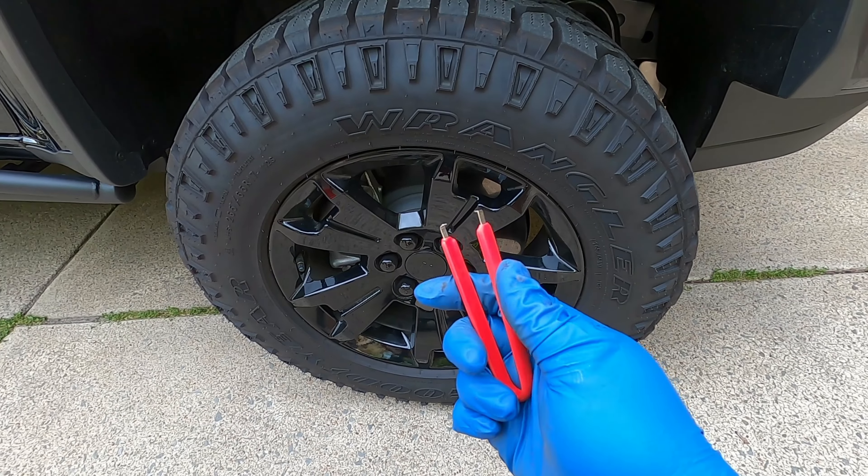If you've made it this far, you are pretty much done. When you get to the step of reconnecting the sway bar — if you're doing the passenger side after the driver's side — the sway bar doesn't have any give. So if the bolt is not long enough, you're going to want to employ some sort of jack. In my case, this is the factory bottle jack underneath the wheel spindle — just push up on everything to show enough thread to get the stock nut back on top of the sway bar extension.